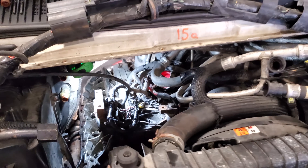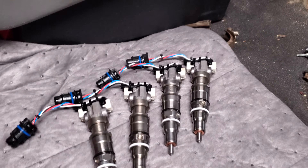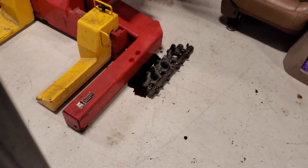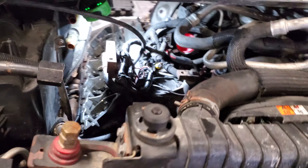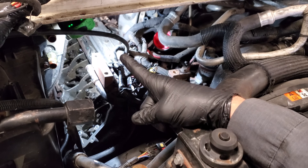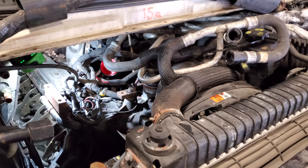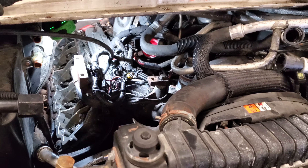I did verify the complaint and found that cylinder number three was not producing any power. After completing the injector click test I was able to find that cylinder number three's injector was not responding. So we gave the customer a choice — replace the one or all on that bank — and he decided to replace all of them on that bank. However, he did not want to use Motorcraft parts and brought his own. Kind of bummed about that, but it is what it is. Can't warranty him, but I'll use whatever parts he wants.